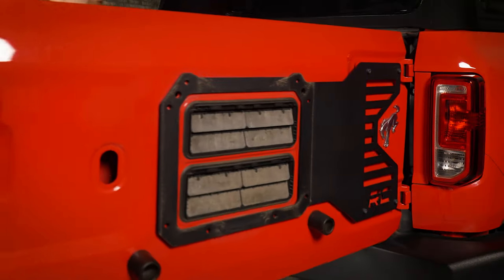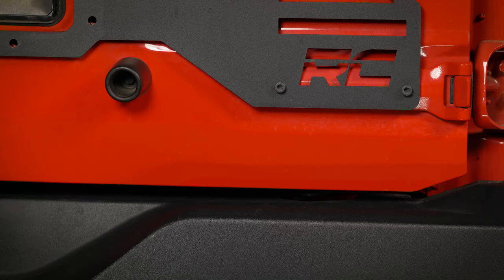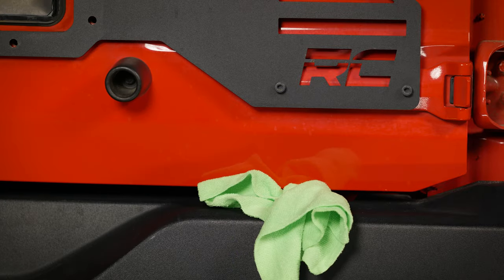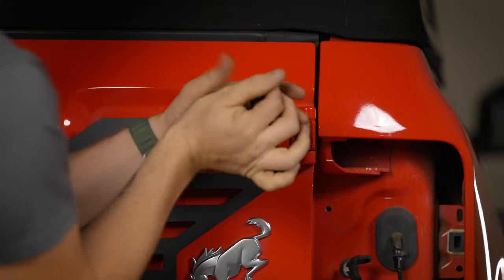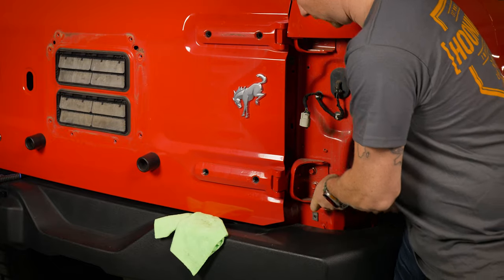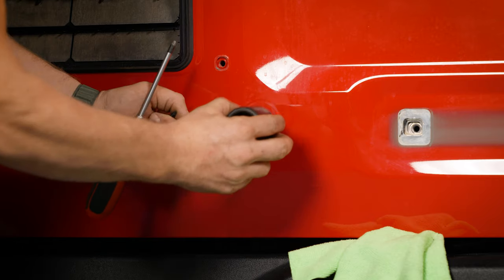Make your way to the bottom of the door and remove the strut. Take a flathead screwdriver, reach up, and pry the little tab down. Once the clip is removed, pull the strut away. Close the tailgate and grab a wedge wrapped in a microfiber cloth so you don't scratch the paint, and wedge it in to support the tailgate from falling. Remove the four bolts holding the two hinges — yours will have a T40 Torx. Then use a 13-millimeter socket to remove the six bolts holding the hinges, being careful as they have some weight and the top one needs to be angled to avoid scratching the paint. Also remove the rubber stop on the right side, as you won't need it.